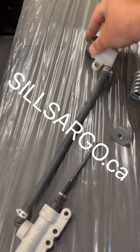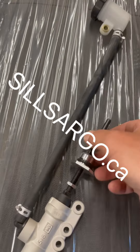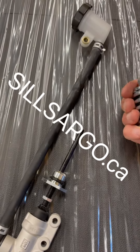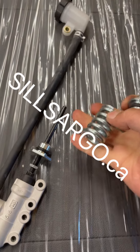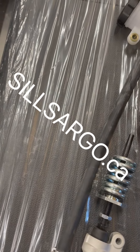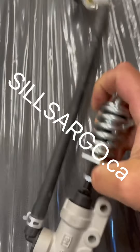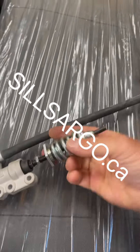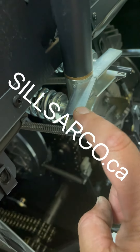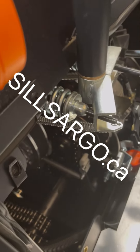There's your master cylinder and reservoir. This piece here slides down the shaft and threads onto the master cylinder. Then you have a spring that slides on, and this end piece that cups the spring pushes it all together — it's got a little o-ring in there. This slides all together and then sits in your steering shaft. When you turn the handlebars, it pushes on that spring — you can see that right there.